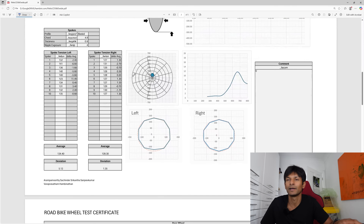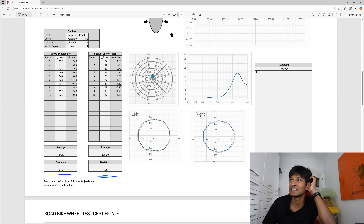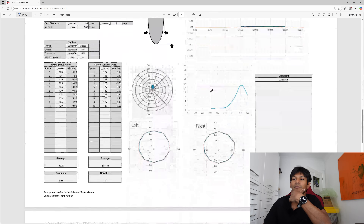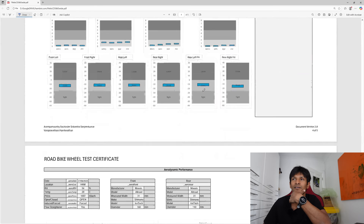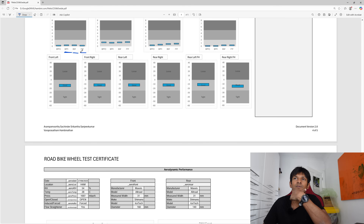This is the test sheet for the wheel. The spoke tension deviation is really, really small. The run-outs were just like zero everywhere — really top dollar. They were the best, and the critical speed is extremely high compared to other wheels. I think that's mainly because it's cross-laced. The hubs really are a work of art. The ball pass frequency — outer ball pass frequency, ball spin frequency, and fundamental train frequency — they're all so low it's just best in class. I can't really say more than that. The run-outs are just zero, zero everywhere.